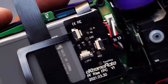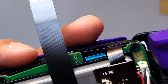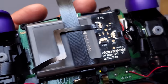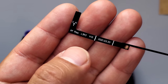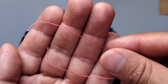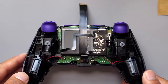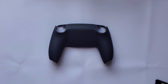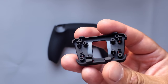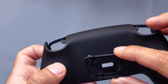Just so you know, the connection right here is for L3/R3 — I'm not going to use that because you actually have to solder some cables. Those two extra cables are basically for soldering so you can program it to your touchpad, L3, or R3. Now I'm going to assemble the back shell. The first piece you're going to need faces this way and you just place it right on top of the back shell — you'll feel how it falls into place, aligning with the holes.